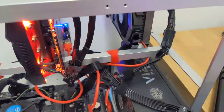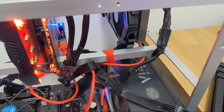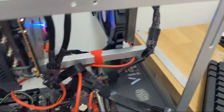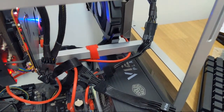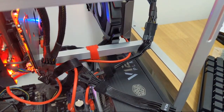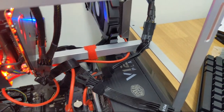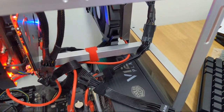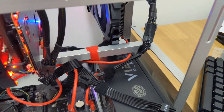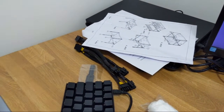Okay, I need to use a miner that's compatible with AMD. Okay, hold on. I need to make a new flight sheet here. Yeah, I just saw that, Michael V. Okay, let me just make a new flight sheet. One sec. Ethermine, U.S. West. Miner, we're gonna use Phoenix Miner. All right, create flight sheet. All right, done. Let's go here. I'm gonna choose the flight sheet. There we go.